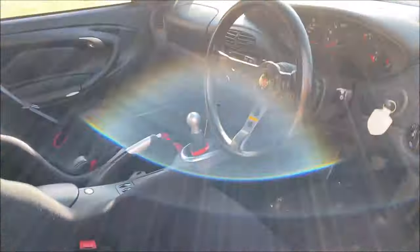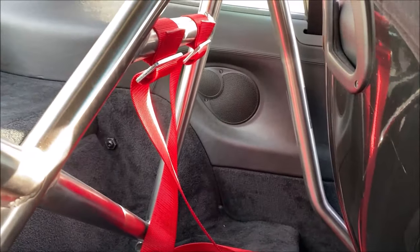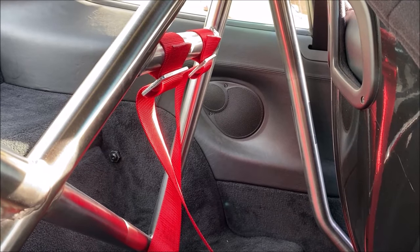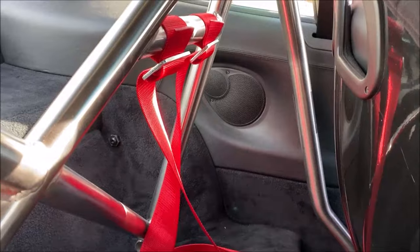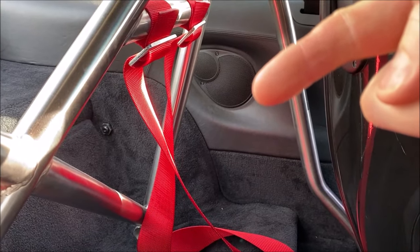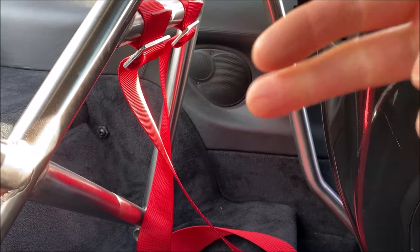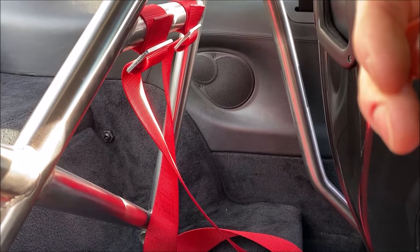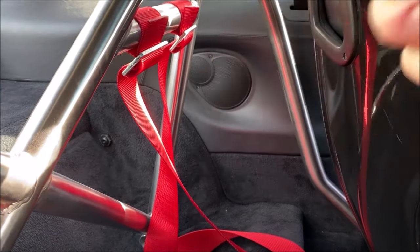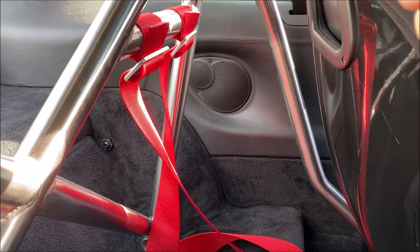The speakers are mounted in on little Torx T20s. You can see the two there on the front speaker, and in the rear you can see the two little Torx on that too. Those two T20s plus a little metal spring clip at the front - undo those two, pull out the speaker, release the spring clip as you're pulling it. Then there'll just be the plug for the speaker wires - unplug it and the speaker's removed. Should be a doddle.